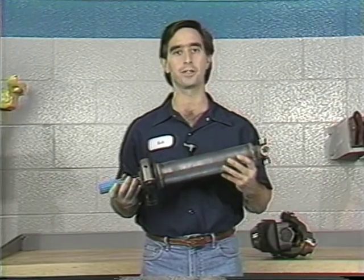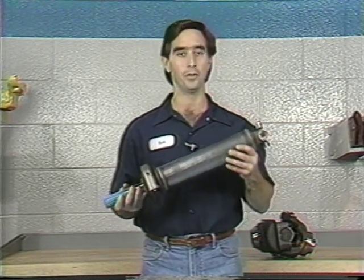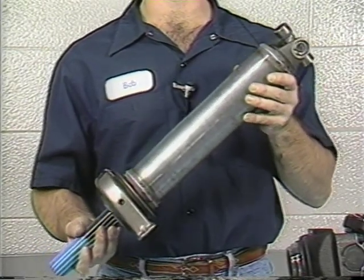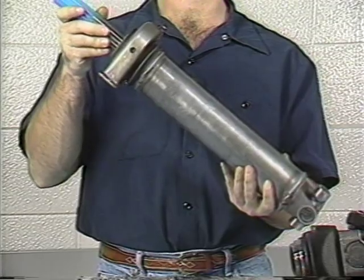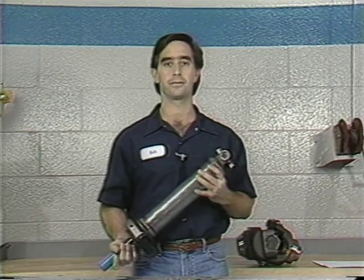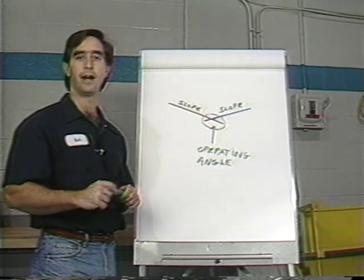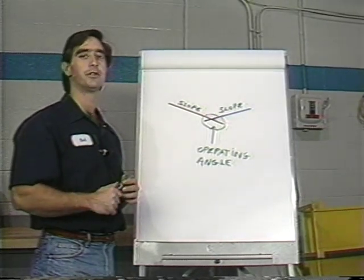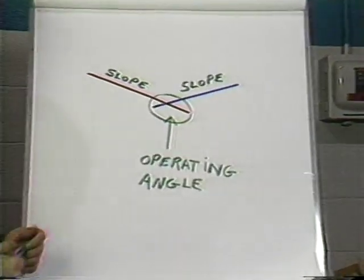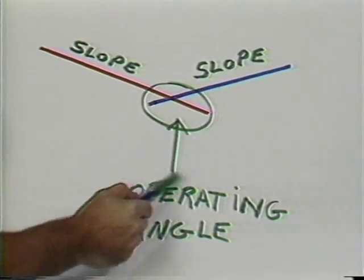If you noticed, as I measured slopes, I said they were either up or down. This refers to the inclination of the slope as viewed from the side of the vehicle. If the slope descends from the front to the rear of the vehicle, the slope would be down. If the slope rises from the front to the rear, it would be up. Now that we have accurate measurements taken, let's calculate our angles. Before we start the math, let's take a look at what we mean by a universal joint operating angle. We need a universal joint to transmit power through an angle — this means we'll have two slopes intersecting each other at a given point. The point where these two slopes intersect will form an angle. This is the operating angle.